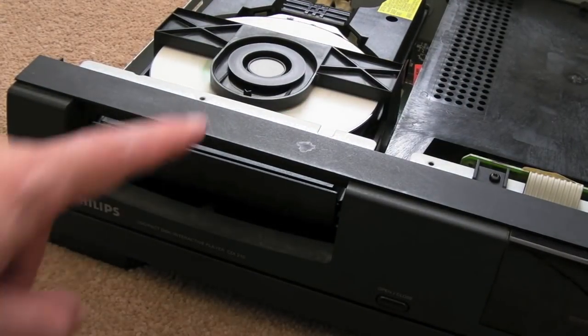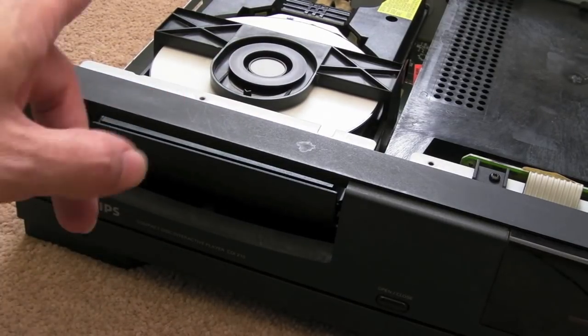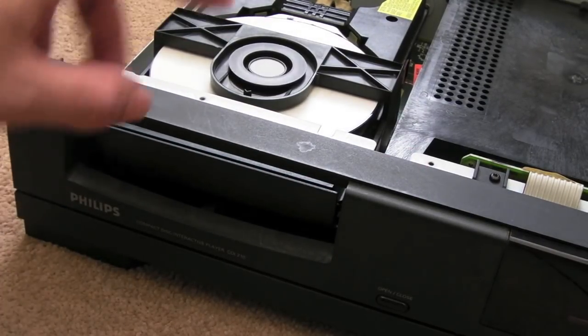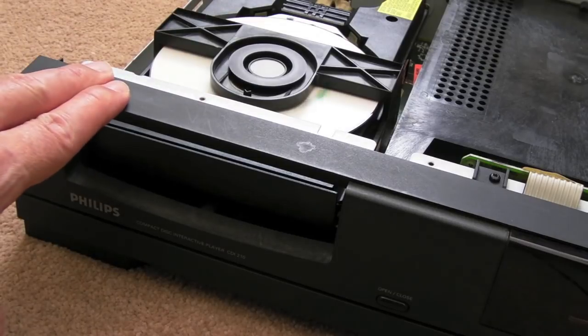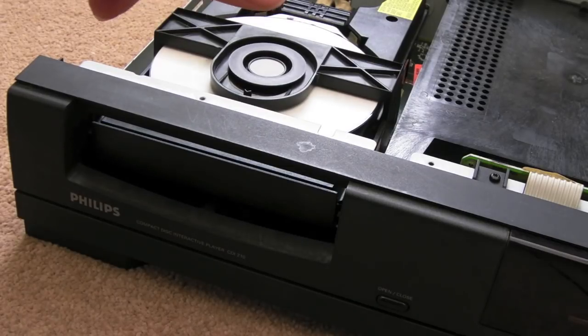I'm quite surprised that the issue I've had with this, with the spindle being pressed, is not listed as a common fault, because I have seen that. I saw that on Retro Game Tech's video. When I pointed out, oh, it's the spindle, I think, he thought it was the motor at the time. And it was a fair point, it could have been the motor. But the fact it was very, very low down, that was the clue. If you ever see a spindle like that, where it's pressed right down, touching, and you turn it and you can feel it grinding, it's not necessarily going to be the motor. You've got to look at whether the spindle is actually touching something, and whether you've got some resistance there from the spindle.